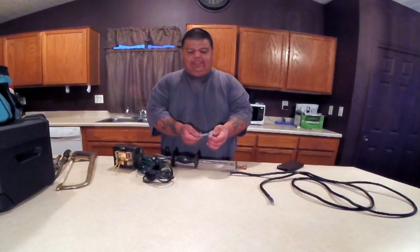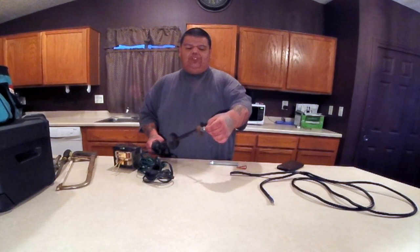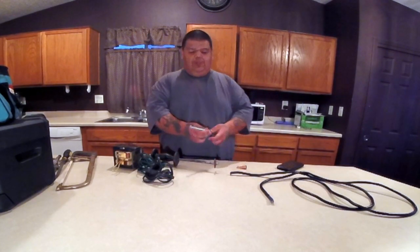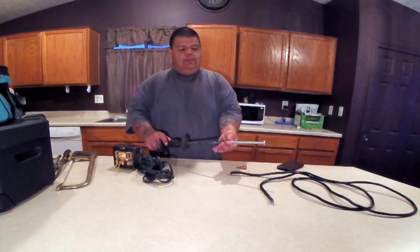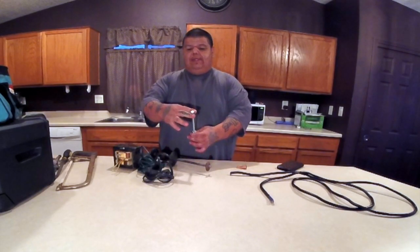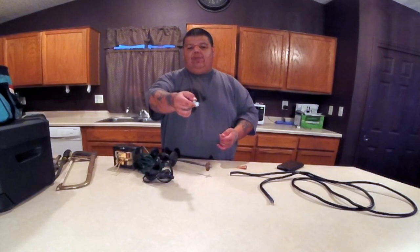Here's the setup. I have a bolt and these two nuts. This end is the original part of the dent puller — it goes on top and had a screw that screwed into the panel to pull out the dent. We don't need that screw. This bolt assembly is going to be our new tip. I'm going to weld these two nuts to the top like this, and the whole assembly goes onto the dent puller. I'm going to cut this tip off, sharpen it to a point, and that's what arc welds to the dent so we can pull it out.